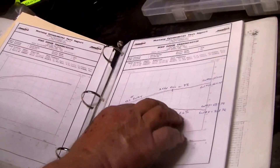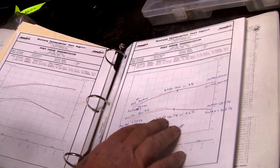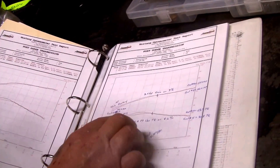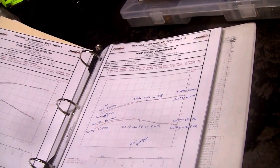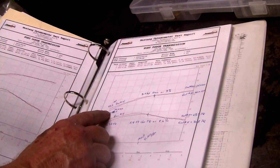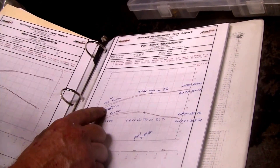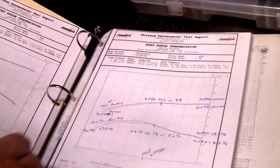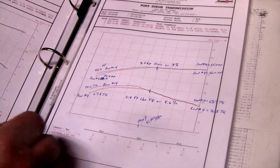The thing I want to point out here is this is one particular run, and it's one of the more dramatic ones, but regardless, we had a 3.5 horsepower gain — or 9% — running this hybrid crankshaft versus a Monte Carlo or GT. You get the same kind of return on the torque. You really feel the torque when you drive these cars; that's where the big gain is.